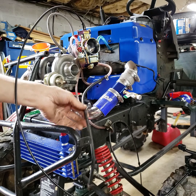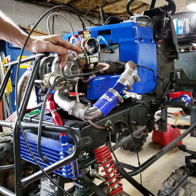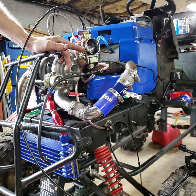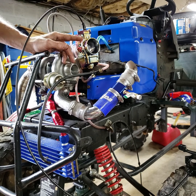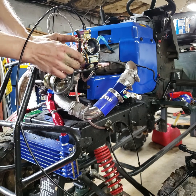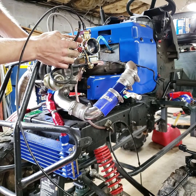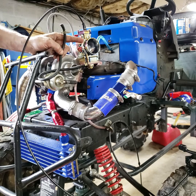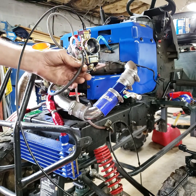I got it tuned to the point where if I manually blow into here, it creates pressure to force fuel up the power jet and out of the power jet itself. If I do it at the right PSI with my mouth, I'm able to get the machine to rev out like I would want it to with the turbo on. Now I'm just trying to figure out if that's similar to the PSI in the charge pipe and if I can plumb them together to work.